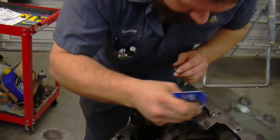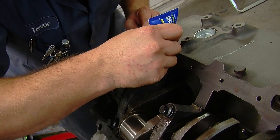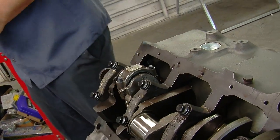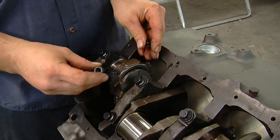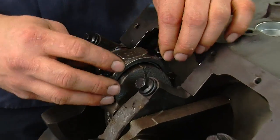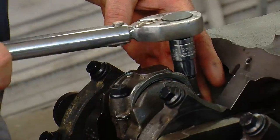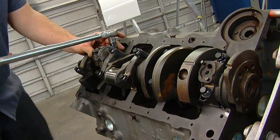It's important to get the proper torque reading. I always use a little bit of assembly lube so you know you're getting it tightened down to the spec they want. Once the bolts are torqued on the first rod, you repeat the process for the remaining seven pistons and rods.